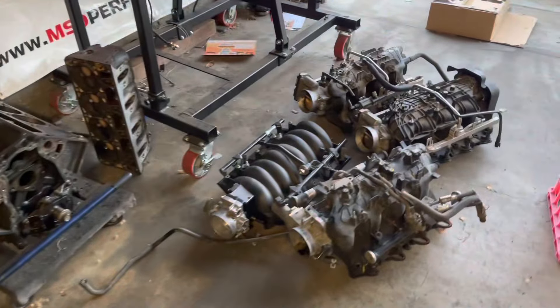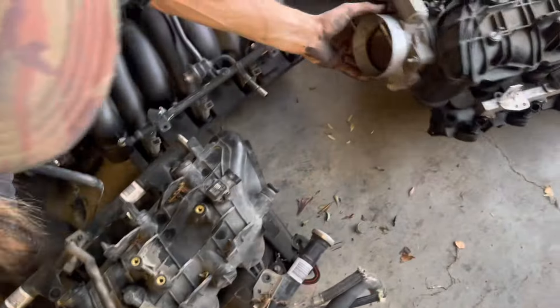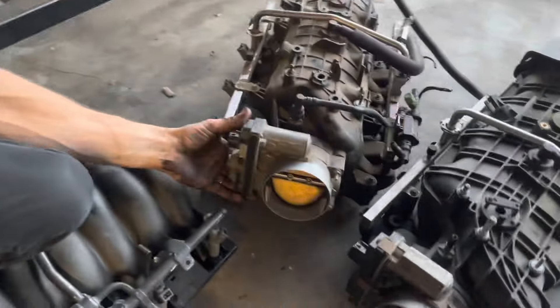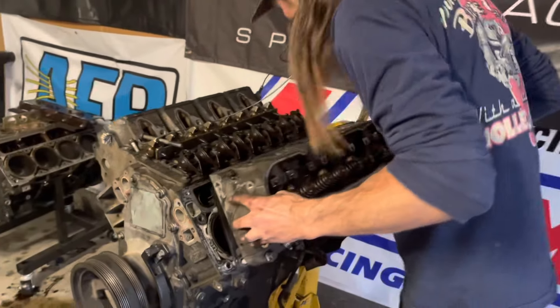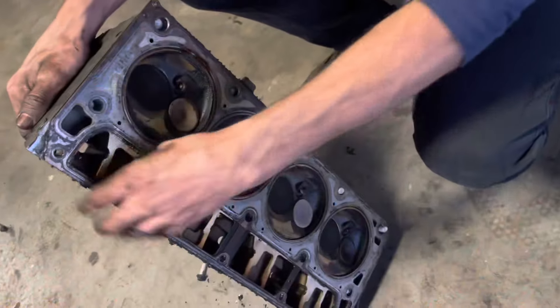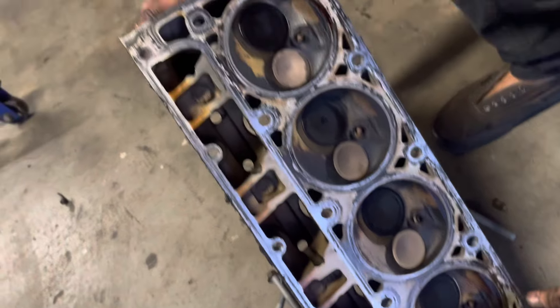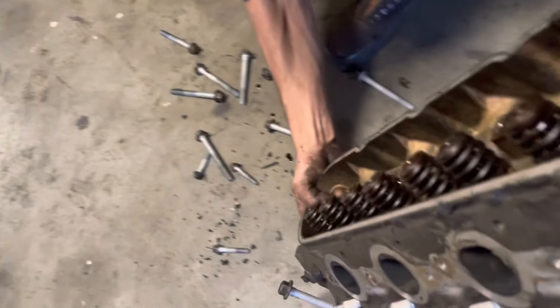So far, so good. Another weird quirk about this engine is that it has the Gen 4 style coolant crossover. The Gen 3s have the coolant going through, but Gen 4 does not — that's why they have them slightly lifted. That's part of the reason why this guy has the same upwards tilt as a Gen 4, because there's no crossover. I see no cracking as of yet. Head gasket's off — all cylinders look fine. Don't see anything wrong.